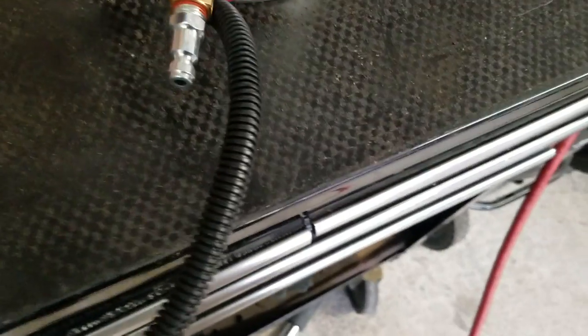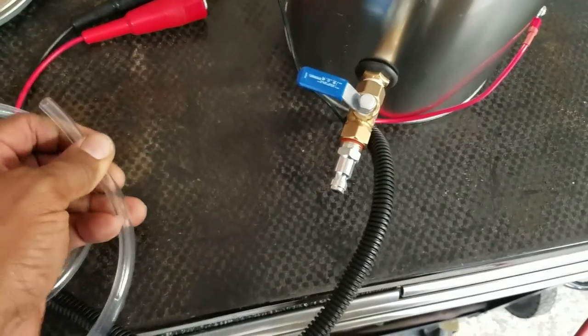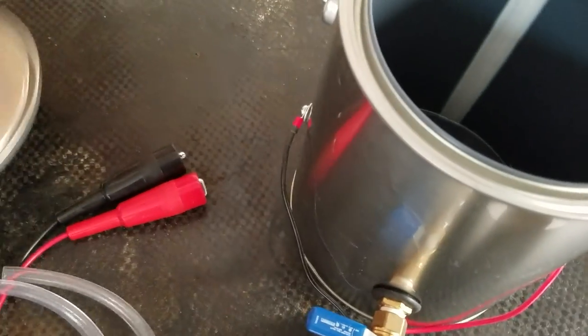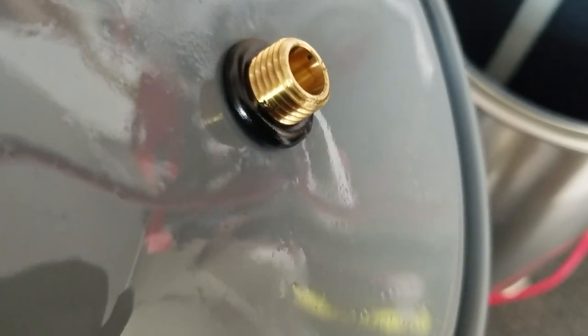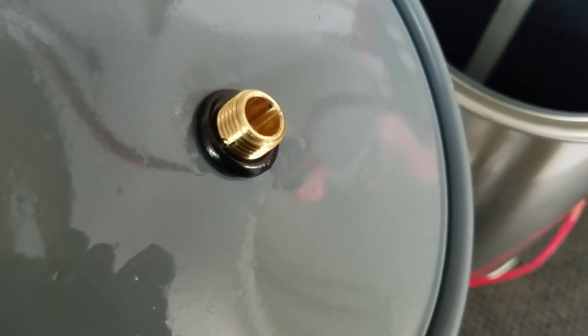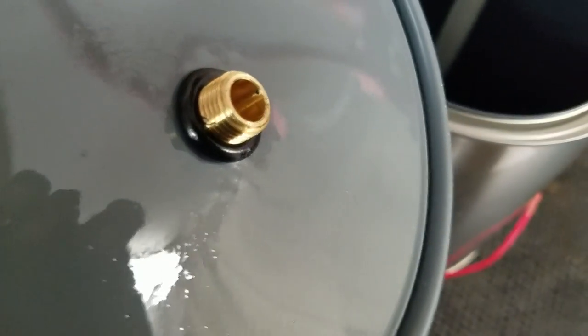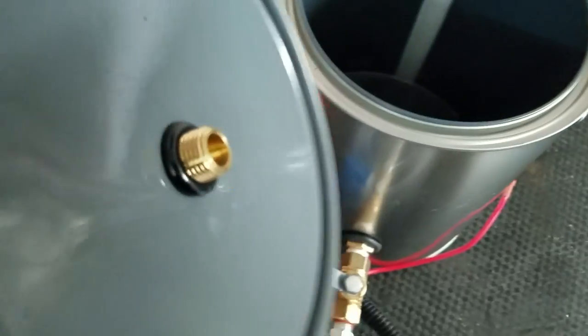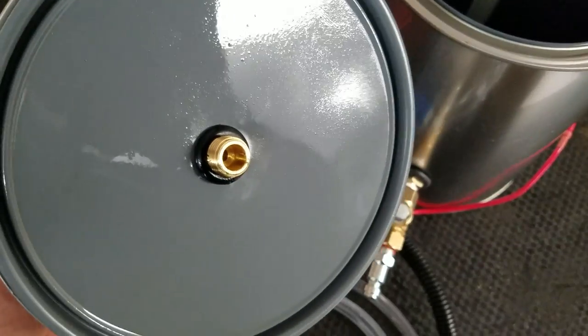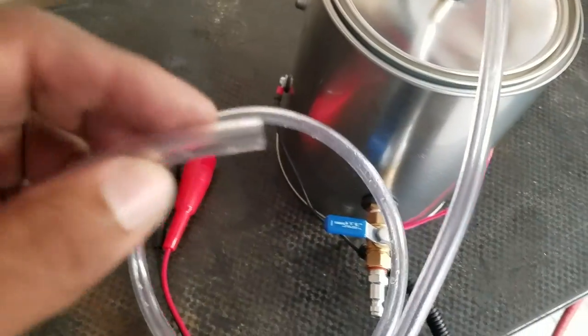To finish it off, you need air — once you heat that smoke up you want a way to push it out into the intake under pressure. They say not to use more than one or two PSI; any more than that actually blows the lid off. The lid uses the same setup with sealing washers on both sides, and I've got a barb connector I just screwed through — no nut — and it holds pressure fine because it's a tight fit. The smoke comes out of the pipe.